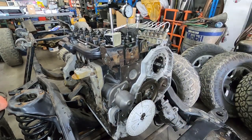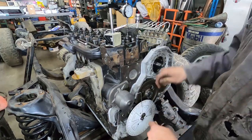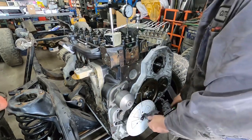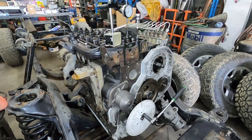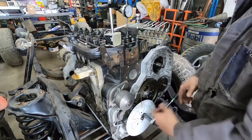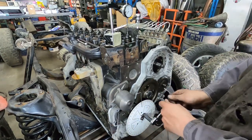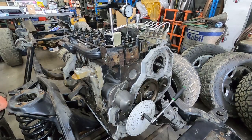Sometimes you have to adjust the wheel to get it in the right spot. I was halfway through the process before I realized I should do a video, so basically you do it until it's the same on both sides. Now take the rocker back off. If you were setting timing, your top dead center is right there — that's the drop valve method for figuring it out. With the harmonic balancer, if you were at 10 and 10 you would just mark each side, find the middle using a ruler or tape measure, mark that middle, and that is your top dead center.